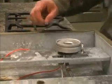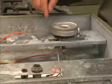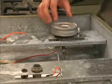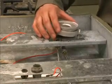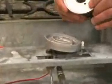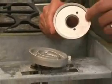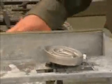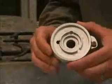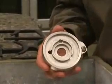That's how they're able to do it, by sending a completely different gas control system to this simmering feature. And here's what I mean. I'm going to take this piece off. Basically, you've got 2 parts here. You've got one piece and then another. During your regular burner features, everything but simmer, all your gas is coming through your center outlet. However, in simmer, I'll slide this off, your gas doesn't come out through the middle right here. It comes through this small port on the opposite end.